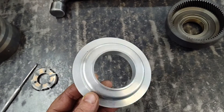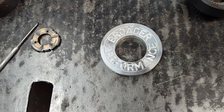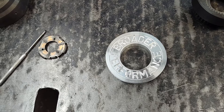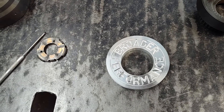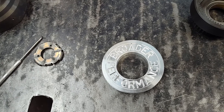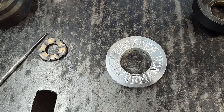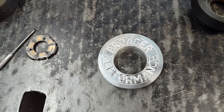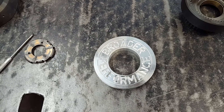This piston here — I make this, this is my design — because this is a small unit, it needs a lot of pressure, and what happens is the disc spring will get overturned and bent if you're running high pressure, especially if it's fixed pressure. So this is something that's important. I've been out of stock on these a lot, but today is March 26, 2024 — I've got material coming and I'm gonna be making some of these. A lot of people have been asking when these are gonna be back in stock. Hopefully in about two weeks I'm gonna have some for sale again. I apologize — these are time consuming to make, but they're important if you're running high pressure and fixed pressure.